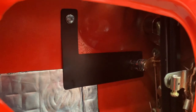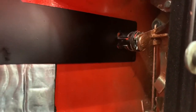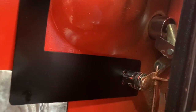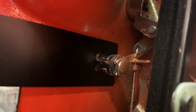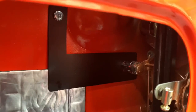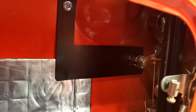That's the bracket in question fitted in place. As you can see, it's made quite a tidy job of it. I've copper-greased up the mechanism. When I turn the key from the other side, as you can see, it is a decent fit — not really a lot to do to make that work. You can just see the bottom pin there, and why I've had to shorten it, because it bottoms out on that plate. The other one doesn't matter, it just sits over the top. But that's why we cut that pin down. I'm quite happy with that — it's made it a lot more secure.